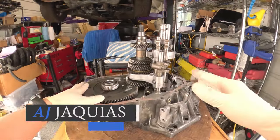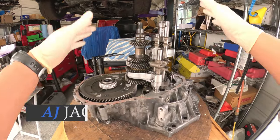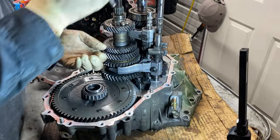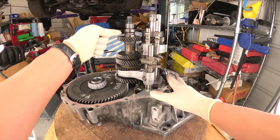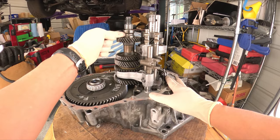In the last episode, we removed Project Yale's transmission case, transmission case cover, and everything associated with fifth gear. Unfortunately, we discovered the countershaft rear bearing had exploded. After cleanup, this is the only piece that remains — the inner race of that exploded bearing.